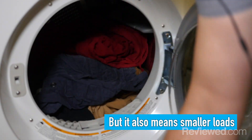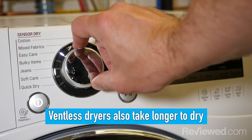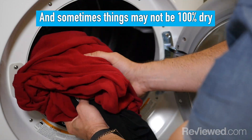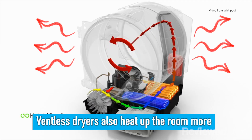The other main trade-off is time. It takes a lot longer to squeeze the moisture out of hot air as opposed to just venting it outside, and when you take your loads out they might still be a little bit moist — they need to sit for a while. Another drawback is heat: because the machine doesn't vent hot air outside, the dryer itself can get pretty hot.